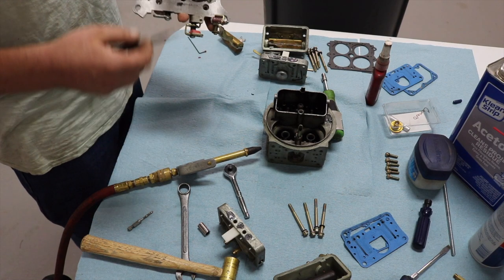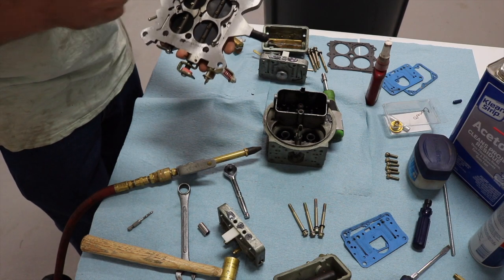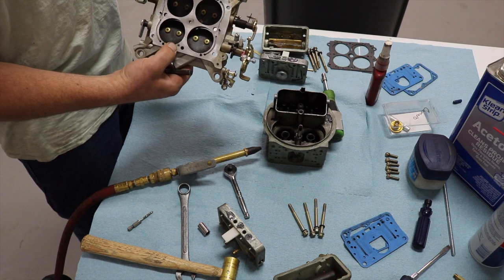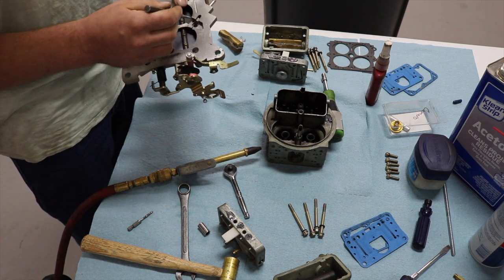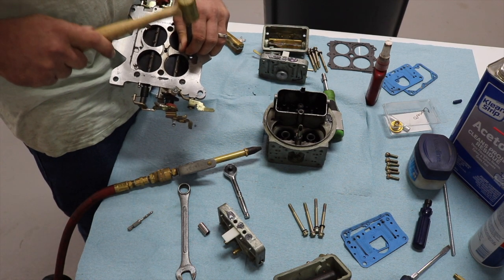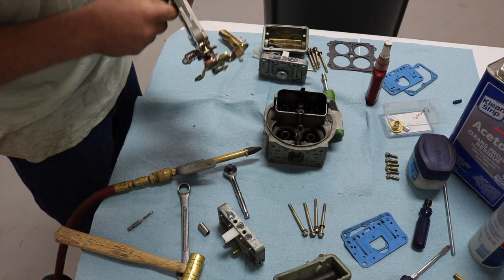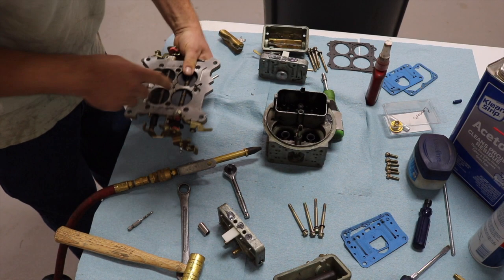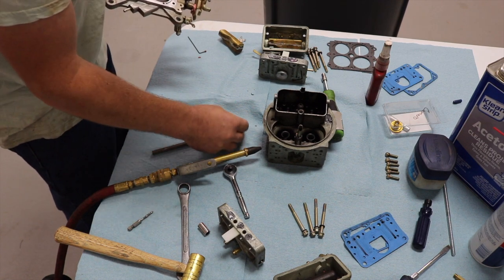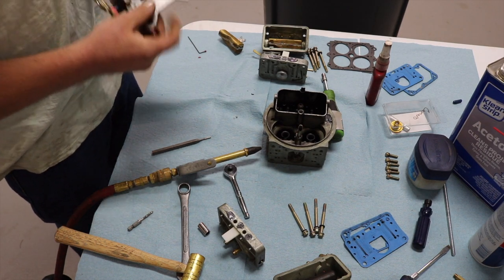The carb is already taken apart — it's four screws, four bolts to take the bowls off. If you can't figure it out, probably shouldn't be doing this. It's six screws to take the bottom off. This carburetor only came with one power valve on the primary side, and there's a little check ball right there. So if you don't want to blow out your power valve, you do have to knock that out because this port is going to get plugged.